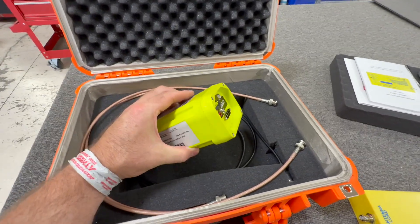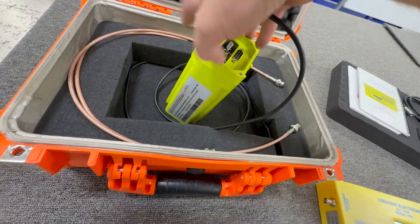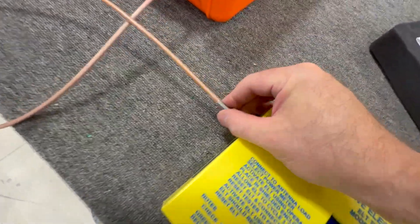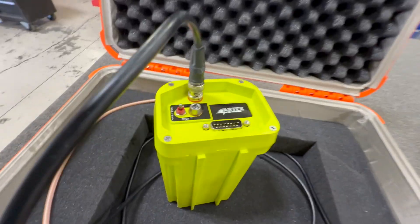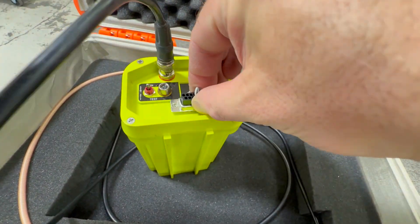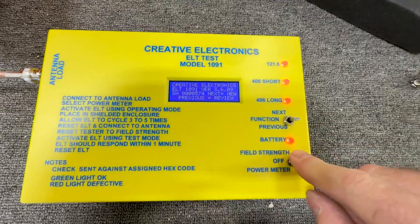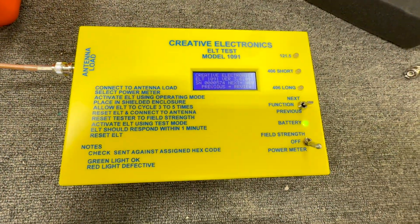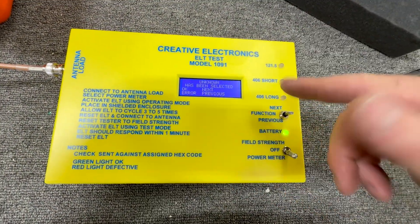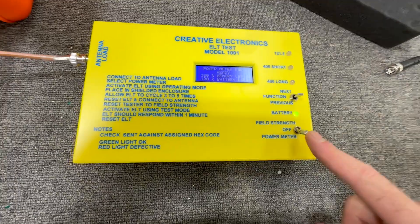First I want to connect this to my antenna cable and also connect my test setup to my tester. One more thing to note: in order to activate the crash sensor, I need to jump a couple pins together, so I made a little test jumper, and that has to be installed, otherwise this thing won't activate. Going into my ELT tester, I turn it on, get it all set up, calibrated, and ready for the test. I'm going to clear out the memory, select what frequency it's on — I'll let it auto-select since I don't know exactly the 406 — and once I'm ready I just activate it, and now this thing's good to go.